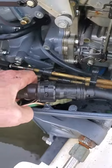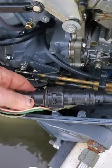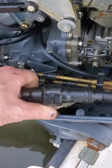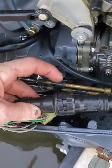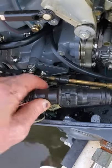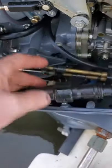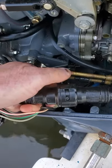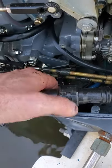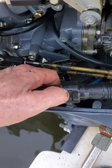Now here's the other thing — Yamaha makes this special 10-pin harness connector. When you first look at it, you're kind of like, I've got to twist it to unlock it. But it's not both harness ends that twist — just the centerpiece. So what you're going to do is hold this piece in your hand. It's probably got oil and anti-corrosion spray all over it, so wipe it off with some rags. Then you have to turn this plastic piece until this notch lines up in that slot.